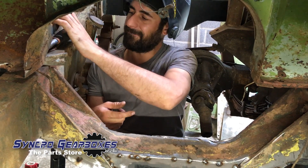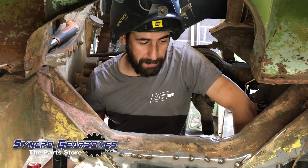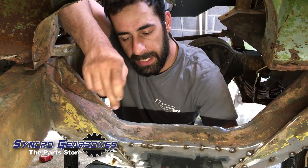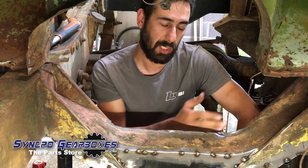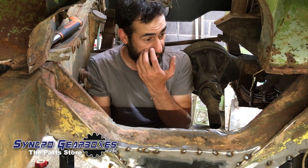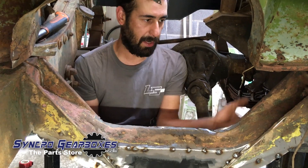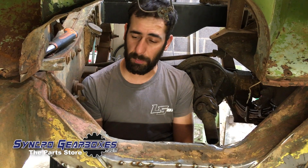I am in here where it's very snug, putting in this crossmember and just tacking it in place, working my way along. I'll put these tacks in here and I'm basically putting a tack down then manipulating the steel as I go, getting it into the position I want ready for when I weld up. It's actually going in really well. I've just got to do some bits along the bottom where it meets the flats of the chassis and then I'm pretty much good to weld it in.